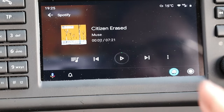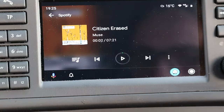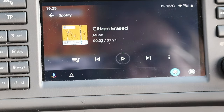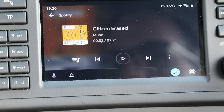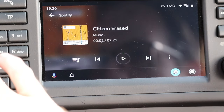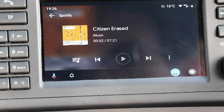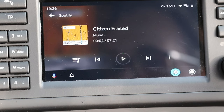Let's talk about some negative points. First, you can't change the tracks of Spotify or your app of choice using your steering wheel — it simply doesn't interact with the car functionality like that. You can still adjust the volume, but you can't change the tracks. The other thing you will lose is night panel for the screen: when you hit night panel your dashboard goes dark, but your screen will not react to that and will continue to be on. And then there's the audio adjustment — you no longer have the original ICM3 screen, so the audio button that would normally let you adjust fade, balance, bass, and treble — you can't see those functions anymore, though they are technically still there and can be adjusted blind.